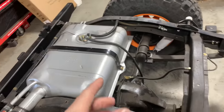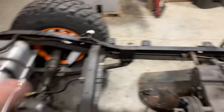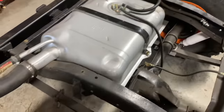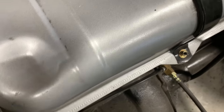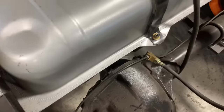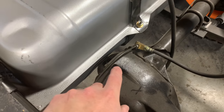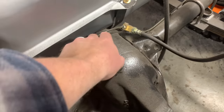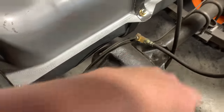So if you missed the last video, when I pulled the tub back off the Jeep and everything, you need to go watch that. I'll explain why all this is back apart. One of the main reasons the tub had to come back off was to fix this gas tank. If you look up in here, you can see there's not much clearance. The gas tank is sitting over the axle right now. I've got roughly an inch of clearance there, so obviously this setup's not going to work. It was better when I did the first video, but once everything settled — the suspension settled, I put a bunch of weight on it — this was actually sitting on top of the diff cover. I actually have that bent in a little bit because it was actually sitting on top of this axle.